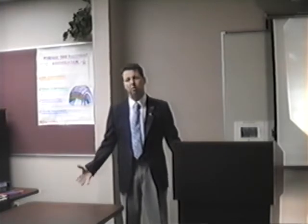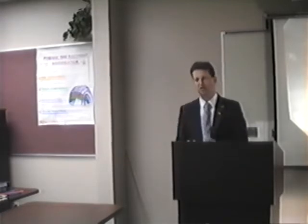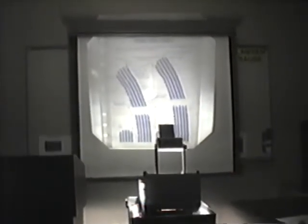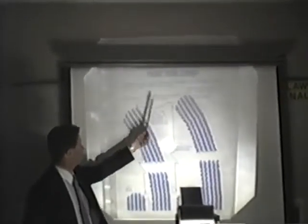There are rare cases when you'll get a vehicle that's been really modified and the rear end is quite narrowed. But if somebody says, no, I know about this front track width problem and I'm satisfied that the tracks were fairly straight, then you measure the front track width across here, from leading edge to leading edge. Unfortunately, you don't always get that exact track width either, even though you're going from the very tip to the very tip, because of the problem in locating that exact edge and also one tire turning a little bit more than another. When you crank your wheels, both tires don't turn exactly the same amount because they're making different arcs. So the engineer set it up so that the tires do not turn exactly the same amount.